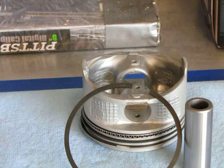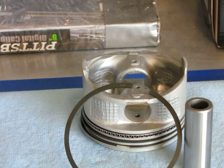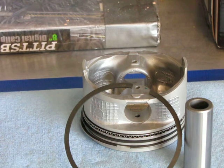There's a simple way — you just turn your piston over, put an X on it, and line up the four different rings with the ends of the X. I'll show you all that after I finish sizing this ring, but I wanted to make sure I didn't forget to mention that the rings are orientation specific and there's a top and a bottom to the rings.